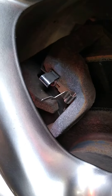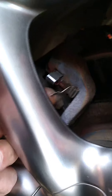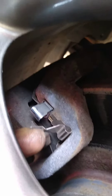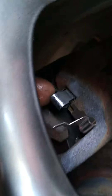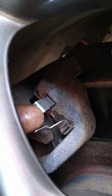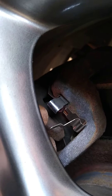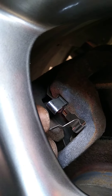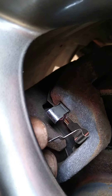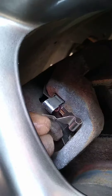A common issue I find with other installers on Nissans and Infinitis is: what is this clip for? Well, that's sprung steel, and it's supposed to fish through the little hole right here — it's a little eyelet. Since it's sprung steel, what it does is move the brake pad, assist the brake pad back after you release the brake pedal. So that's what that little tab is for.